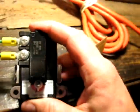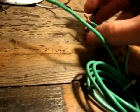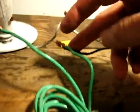It's very simple. The thermostat is just pretty much a temperature switch. One of the green wires — it doesn't even matter which one, and it doesn't matter from either terminal — just one of these green ones has to go on that. One goes to one, one goes to the other. And that is the complete wiring of the thermostat — just from the plug, the black wire goes to one side of the thermostat, and then out the other side it goes to the light. That's it.